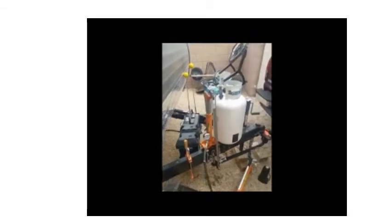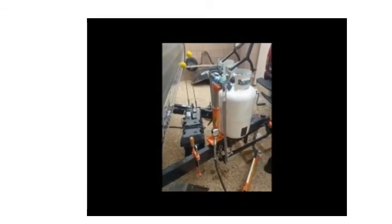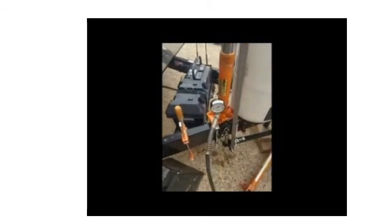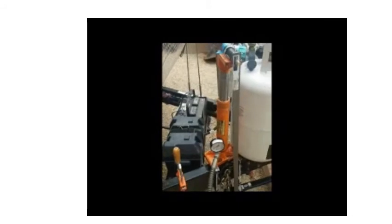A rig that will actually do that. I've taken a power ram and equipped it with a pressure gauge by inserting a 1/4-inch T and screwing a 1000 psi pressure gauge into the T.